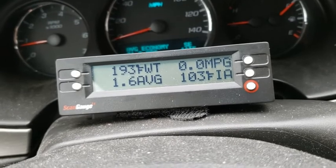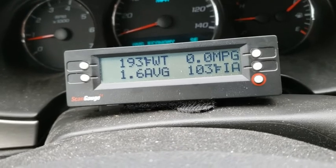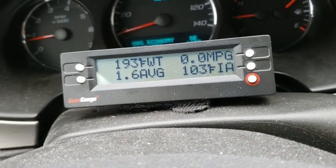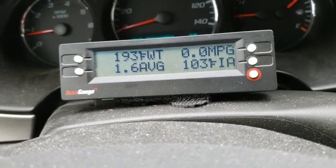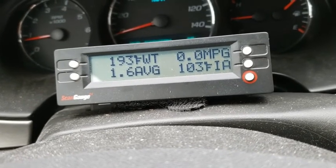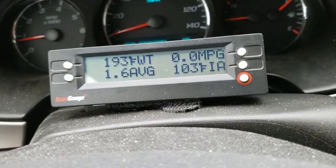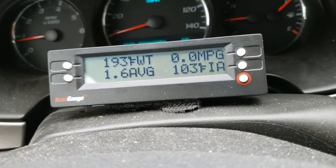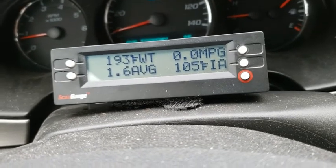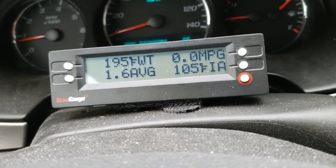The device tells you about problems early if you catch them on the gauges. It's just more information about what your car is doing before a check engine light pops up. If your alternator or battery is going bad, you'll see the voltage drop from around 14 volts down to 11 or 12. A healthy battery should be 12 volts; an old battery will drop below that. I kept seeing it flip between 14 and 11, so I knew it was fluctuating badly and replaced it early.